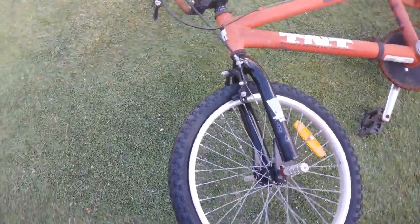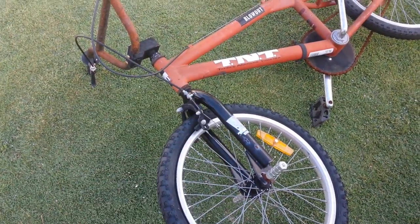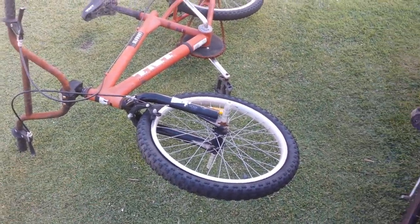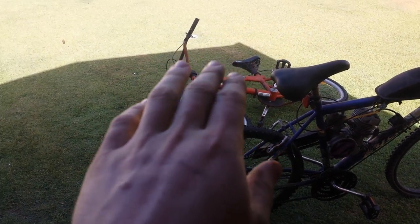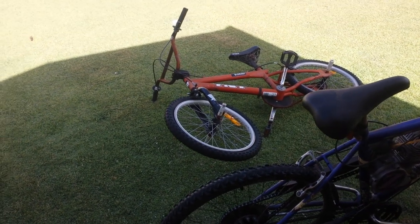What I'm going to do is use the front end of the bike as the cart frame. I'll mount the sprocket — which is currently on the rear tyre — onto the front. I'll need to make up a custom motor mount of some sort. I'll also try to keep the brakes so I've got some stopping ability. You're not really going to go that fast with these things, but it might get a bit hairy. The bike's been sitting there for about 4 years just rusting away, so I'll chop it up and use that rather than buying something new.